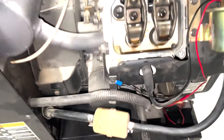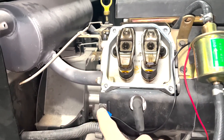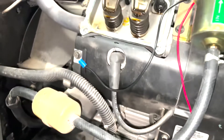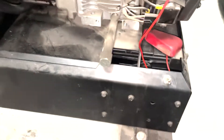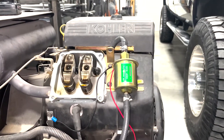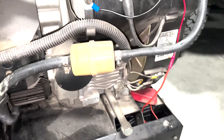Here's how I routed it so that we can control when it's on and off. The negative wire came right here, grounded it, made sure with the multimeter that between here and the battery — which sits right down there — we had a good connection, just ohmed it out. And then the positive just ran right down here to a switch, connected to the other side of the switch to the positive terminal of the battery. Now when we go to turn on the engine, we have a switch and we can just turn on the fuel pump. I made it so down is off, up is on — that's how I like to wire my switches, I just remember it that way if there's no label or anything like that.